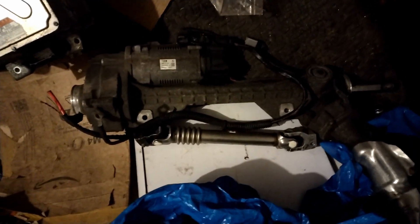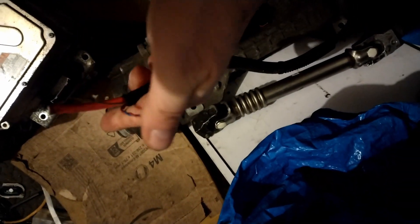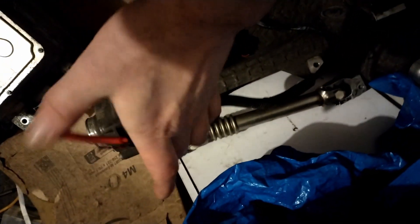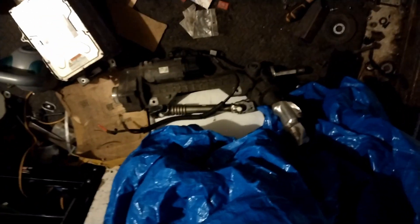What we've got here is a BMW electric steering rack. This is apparently a straight swap for the hydraulic steering rack. All we've got to do is put it in, code it, and extend these wires. One of them is CAN bus, the other is 12 volts and a ground. That's going to give us power steering back — obviously without the engine there's nothing to drive a power steering pump, so this will get one of the two back.